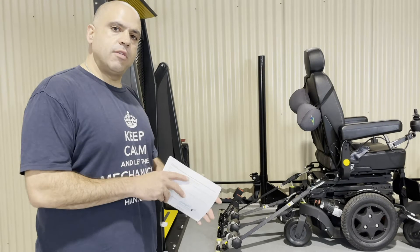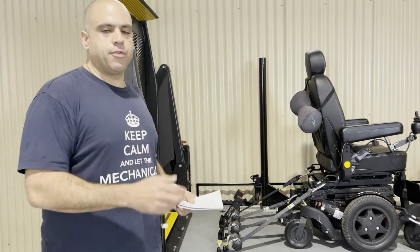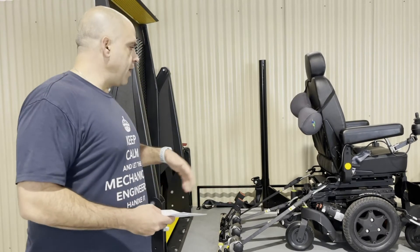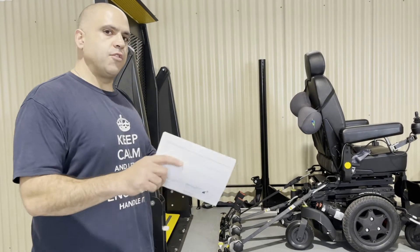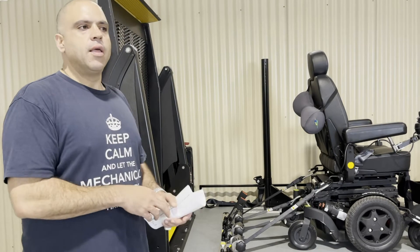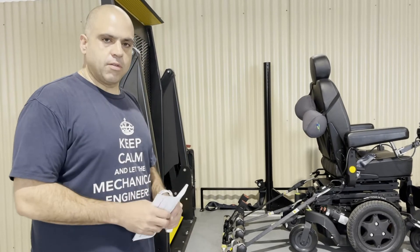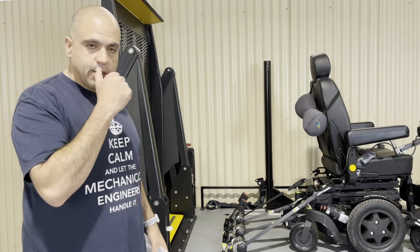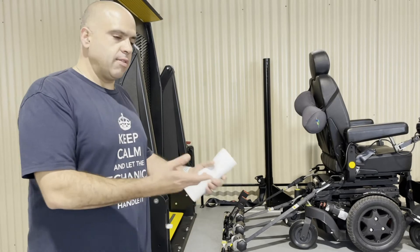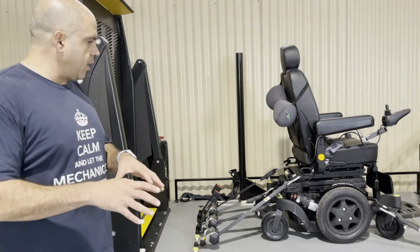Wheelchairs are about 30 to 50 percent heavier than what they were about five years ago, if not more. Wheelchairs are pushing well above 200 kilos now, so the old system of four tie-downs is just not cutting it. You're going to have to add those extra tie-downs if the manufacturer requires it — always check the instructions. This came about because we got an email from one of the manufacturers saying they've tested the chair and it needs six wheelchair tie-down points, and a therapist asked us: is this actually the case?